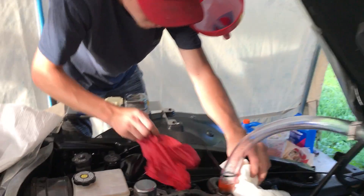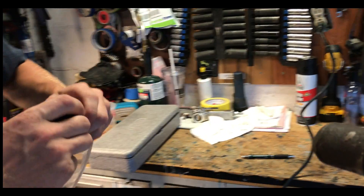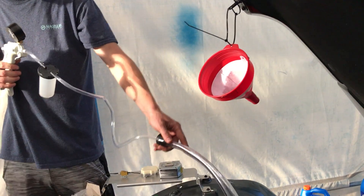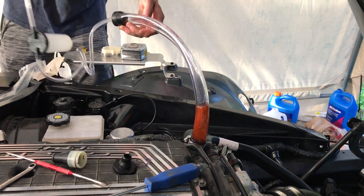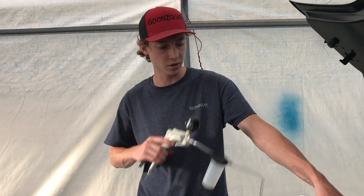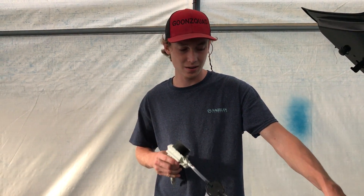Back at the house - rigging this purge system up to get all the air out of there. Going ahead and putting some pressure on it - oh nice, it's pulling it up. Bubbles! I see bubbles - that is what's up, this is where it's at. No dealership for us, we do this for ourselves. We like dealership parts, but dealership services - we'll become the dealership on this one. As you can see we're getting a ton of air out of that system. It's collapsing a bit - I just released the vacuum, going to fill it up to the top again. We're going to do this quite a few times until it's completely mostly air-free.